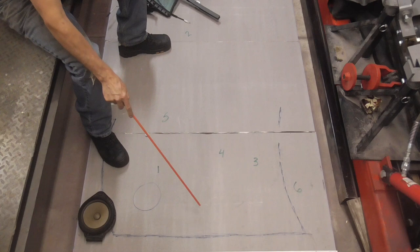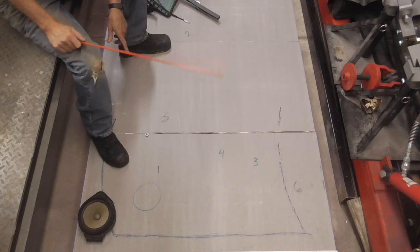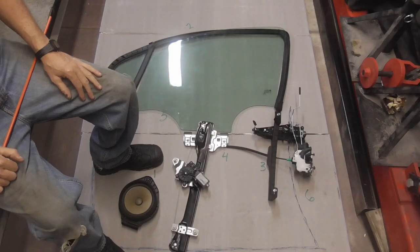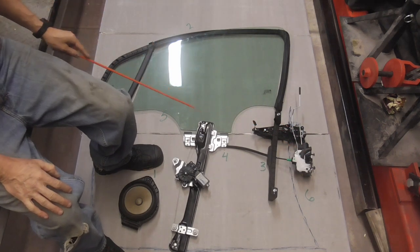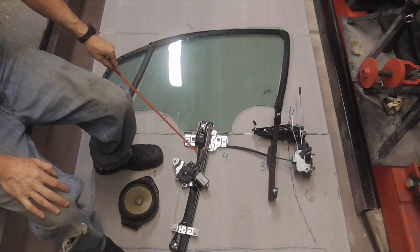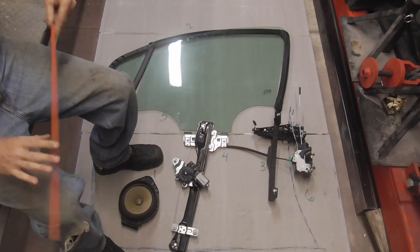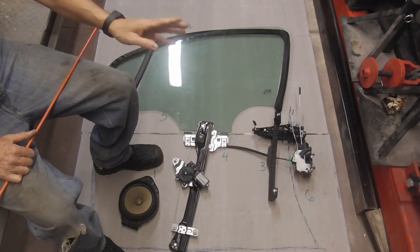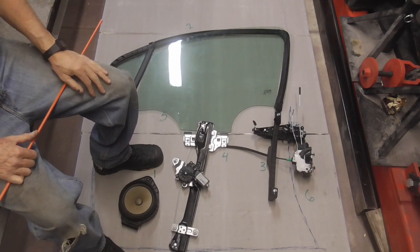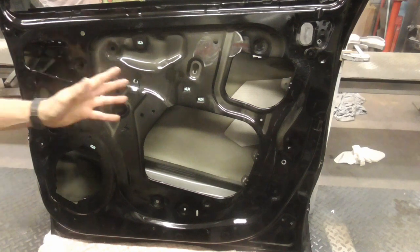If you'd like to see exactly how to remove the regulator and window, I'm going to make a video on that — and exactly how to remove the door handle and latch, I'll make a video on that too. Replacing the parts of the door is much easier because you know exactly how it comes apart — you would reverse the order: install the latch and the handle, slide the window up and tape it into place, install the regulator, the window track, then install the speaker, run your wiring, and throw on the door panel. Disassembling and assembling doors can be difficult, but if you take your time, study each part, use YouTube for help, and be careful, it can be done without breaking parts. I hope you enjoyed this video on removing and replacing the parts of a door — don't forget to hit the subscribe button.